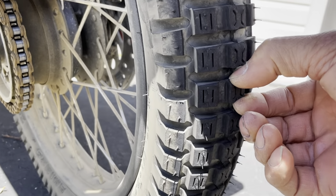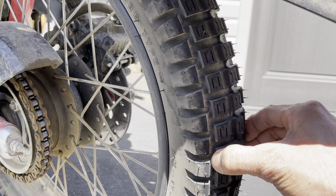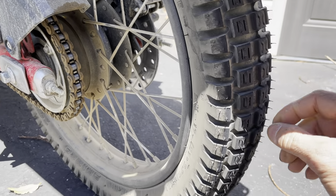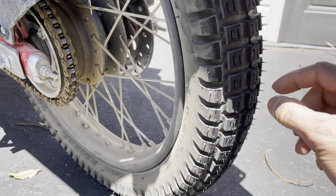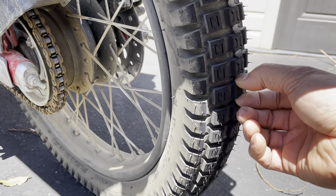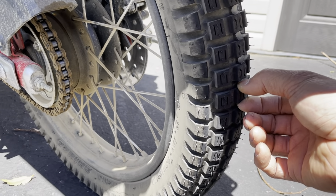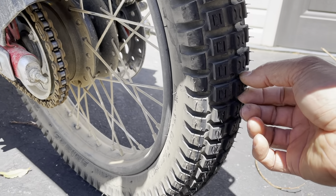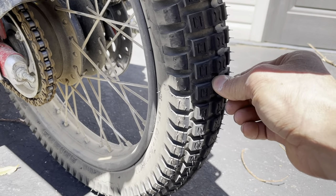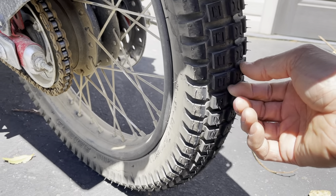Just to let you all know about these tires — I'm still testing and messing around with tires. I actually have full pressure, the Honda's recommended pressure: 25 PSI in the front and 33 in the back. In the dirt, these tires were slipping and sliding all over the place because of the full 33 PSI. What I should have done was leave it at 30 PSI instead — even though it's only 3 PSI difference, it makes a difference.